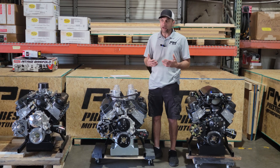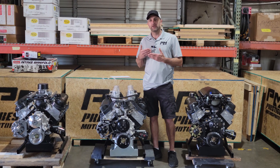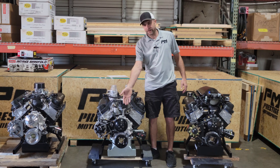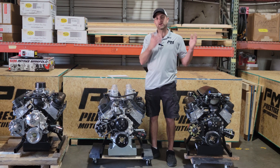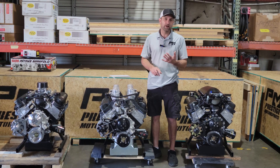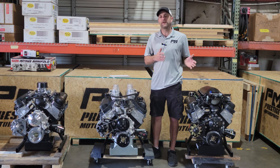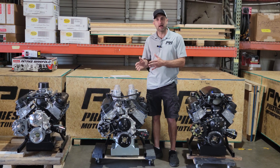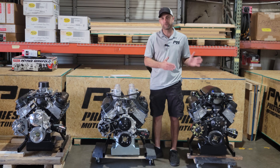What really inspired this was to give you guys a little bit of education on what factors affect the final output of the engine. When we develop a package, typically it's not going to have a pulley stack on the front, and we're going to use a common manifold. When everything started, it was all carbureted, so these 575s used a single-plane manifold with a 750 carburetor and no accessories. That way, when we go back to develop on that combination — changing camshaft or cylinder head — we have a baseline to go back to, without pulleys, accessories, or different induction affecting our results.